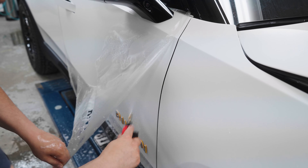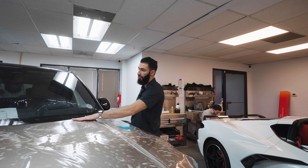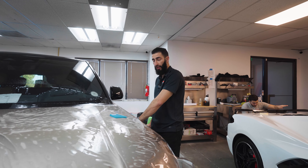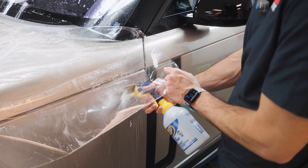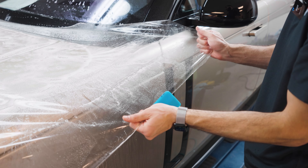We've just laid the film on the Range Rover hood. The material is only 60 inches wide and this hood is just over 60 inches, so we'll only have to stretch it about half an inch or so. To make it easier, we're going to cut the slack where the material catches the hood and windshield so we don't have as much excess. We'll trim that off, tack the back near the door and fender, then stretch out to both sides and the four corners.